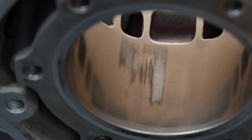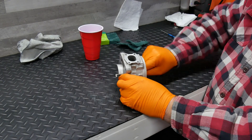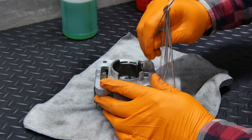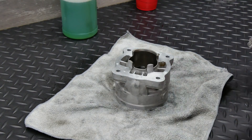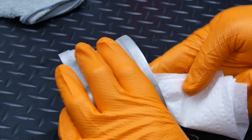Each spot was pretty similar, but I did switch to maroon abrasive pads. Most areas could be done within a few minutes, with some of the larger spots taking longer. I cleaned everything thoroughly, including inside all of the ports, and then washed the cylinder with dish soap and water, before wiping down the bore with WD-40 until I no longer saw any gray residue.